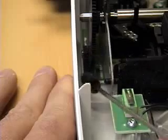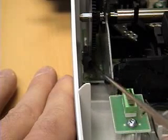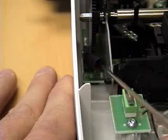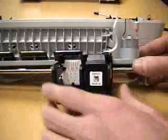At the base of the disc you can see a black component that houses photoemitters, LEDs, and photoreceptors or transistors. And there's usually a set of two of these, so you can generate a quadrature output signal from this relative encoder disc.